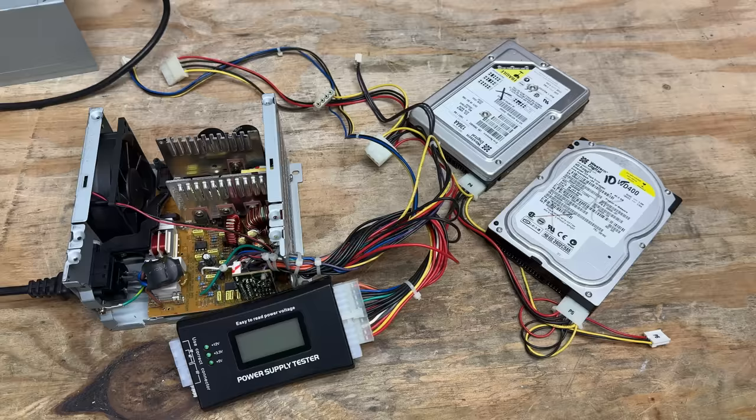That is some perished thermal paste that has turned to thermal glue, as happens from time to time. It sure looks like a Celeron to me. Let's sweep that dust off - we don't need it falling inside the ZIF socket. And as advertised, that's our Celeron - all the pins look good, and I'm probably the first person to ever take it out. Let's get it cleaned up.